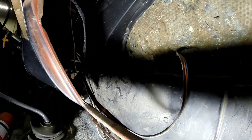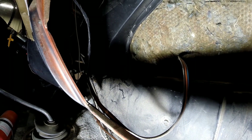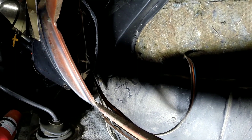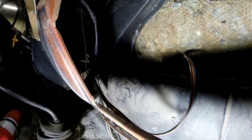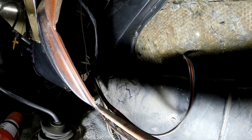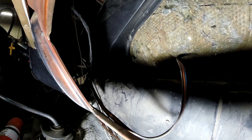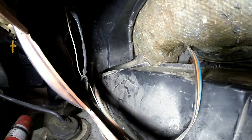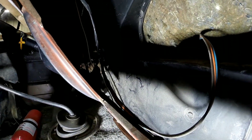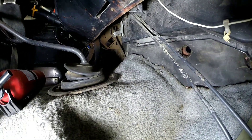Yours may be the same — a lot of times they don't seal up right. There should be a piece of foam or something in there to help seal it, but mine's missing. If you're reinstalling yours, make sure that foam is in there so it makes a good seal, because that's a lot of the reason the defroster doesn't work very well. There's supposed to be a piece of foam between the ductwork — you can see the gap. But let's get this damper door unhooked, and I think that'll be it on the inside.